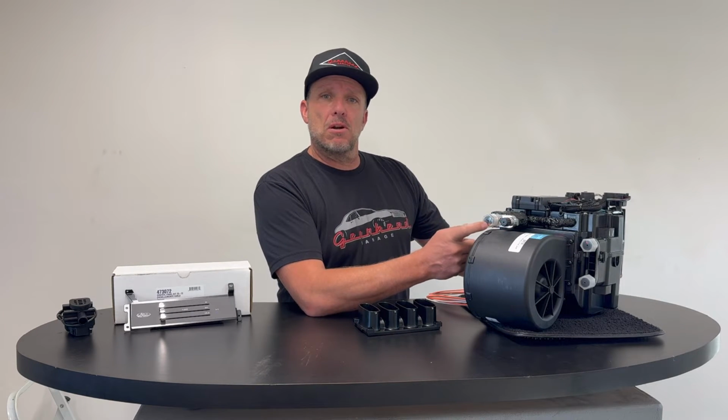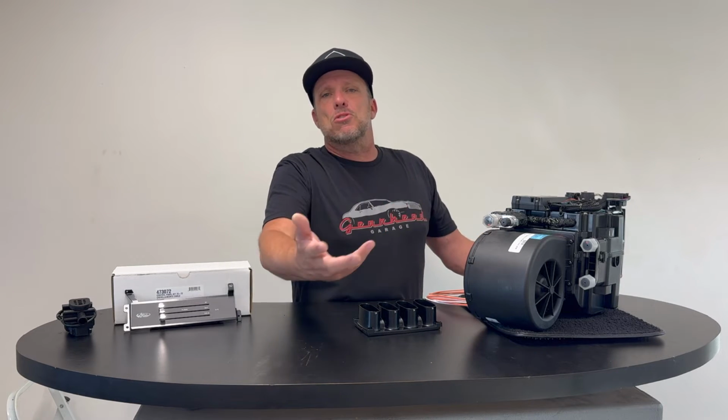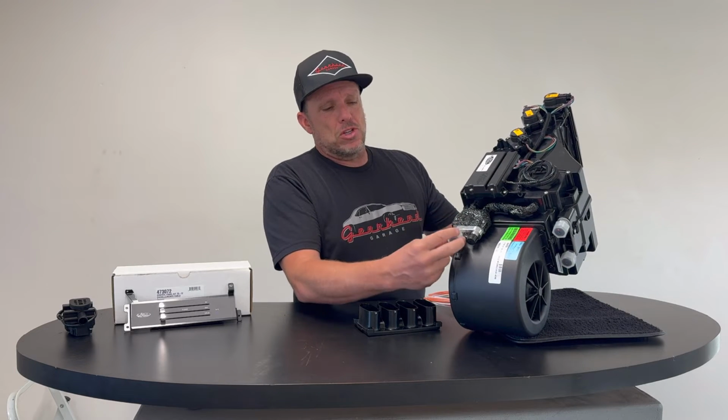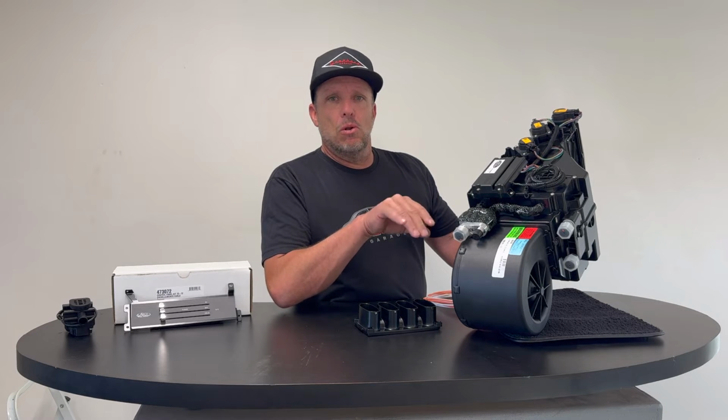On this side, we have where our manifold is, where our hoses come in. This is our number 6 and our number 10 AC line that go out through the firewall to the AC compressor, to the condenser, and throughout the car. They now have a nice billet block on here. Very strong, so when you tighten everything, you're gonna get a nice, secure, lockdown, tight, no leaks done.